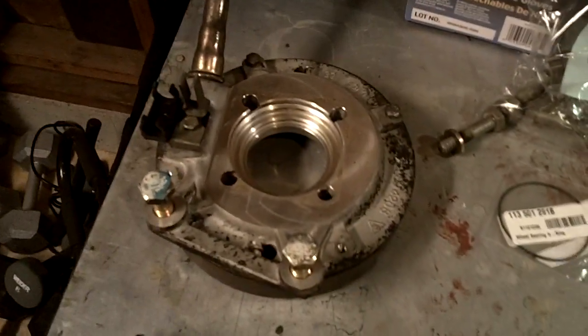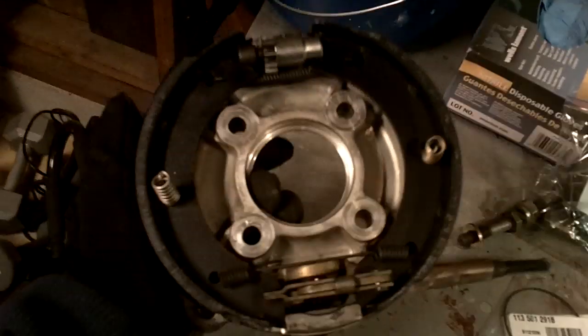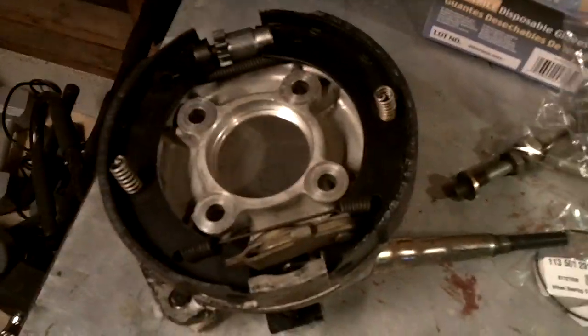For parts, you're going to need a 944 rear hub. This is the 944 naturally aspirated hub — it's probably off of an '83/'84. It's got the rear brake and emergency brake shoes. We don't need these; we're going to take these off and change them out later. But for the purposes of this video, they're going to stay on.